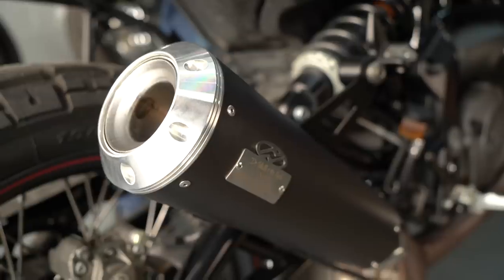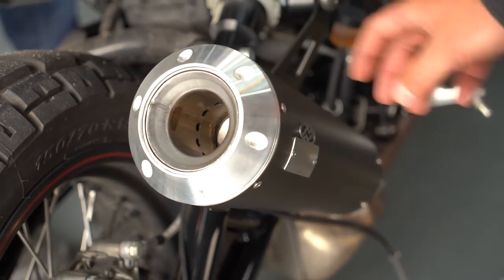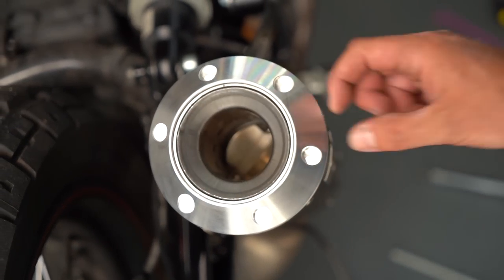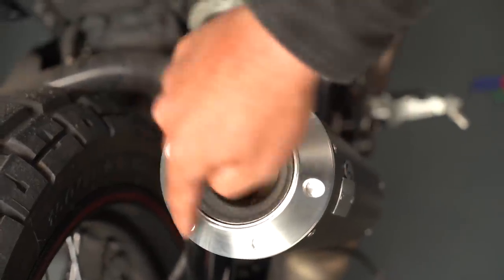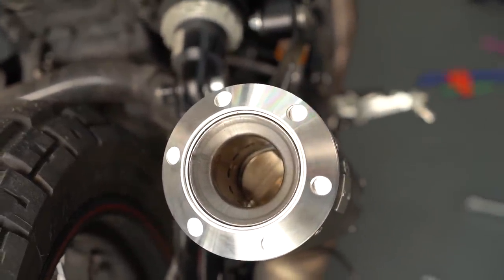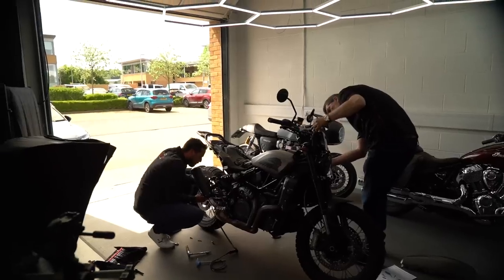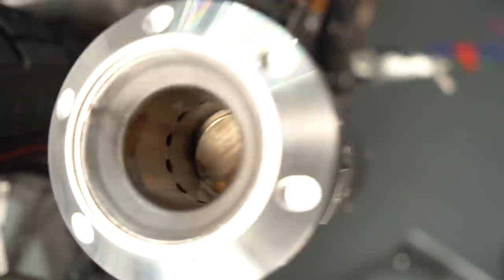Here's a fun story about the Street Fighter design. The first original exhaust was a straight pipe inside an exhaust with a valve at the end — when the valve closed, exhaust gases went to the outside through holes. That was the original Jekyll and Hyde, and those holes are now kept just for looks, as a nice reference back. We've got the silencer on now — you can see the valve easily down the end of it — and we just need to run the cabling. Here's the servo pulling on cables that actuate the valve in the silencer.